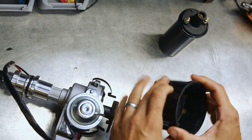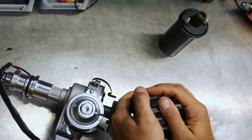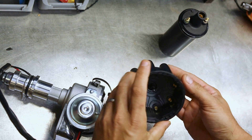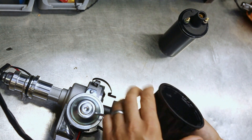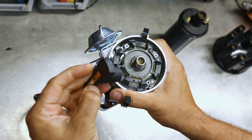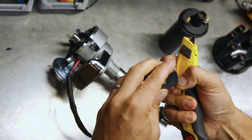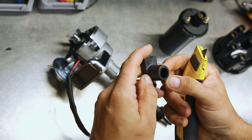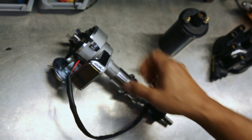The rest of the housing is just left with a completely raw sort of cast feel. The cap does seem to be — it's not quite the same as the later model Clevelands. Those came with what felt like a really robust fiberglass-reinforced nylon distributor cap. This one feels a little bit more brittle. It doesn't have any branding on it, so I'm just going to assume it's a fairly generic piece of gear made in some corner of the world that didn't want to put their name to it. The rotor button is unbranded too, but it doesn't need to be anything special — they were made out of Bakelite for years and they never broke.